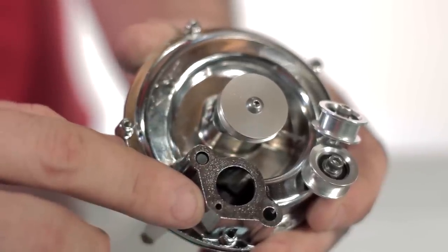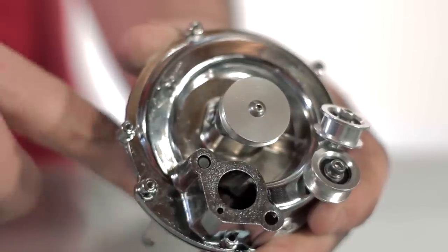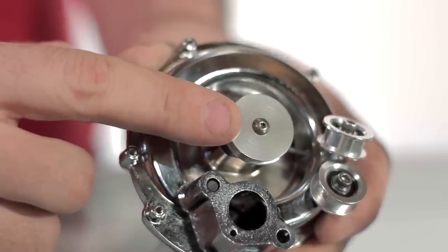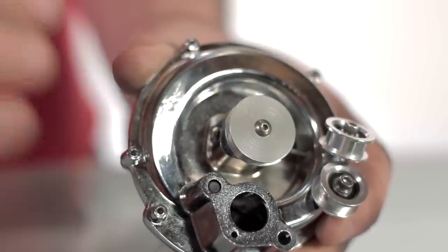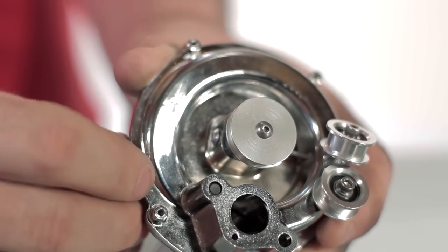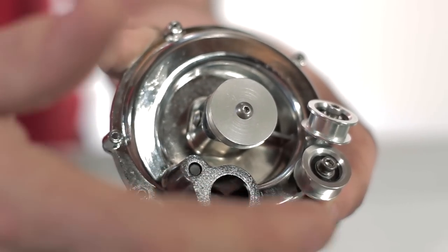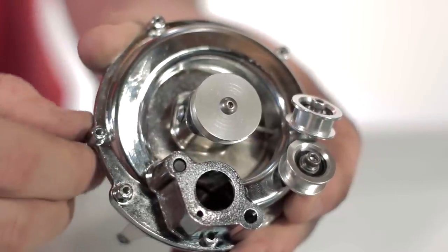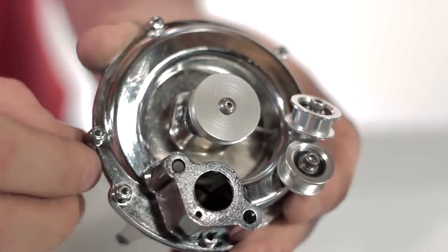Here's your vacuum pickup line which transfers all the way back to the carburetor. This is the overdrive pulley, and we have four different sizes to spool it up to a faster RPM, giving it more boost than the stock pulley that comes with it. And here are our high-speed idler pulleys, which incorporate the 90-degree drive system that's critical with the supercharger.